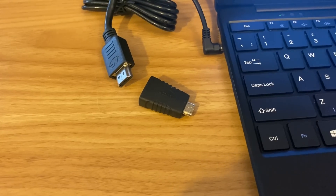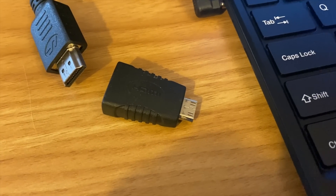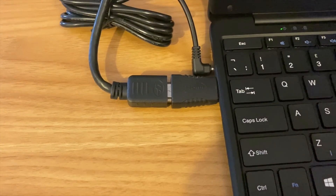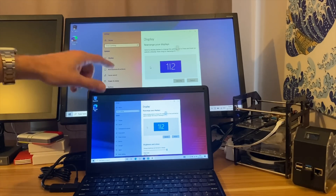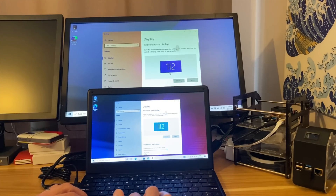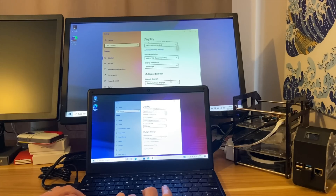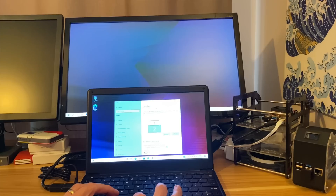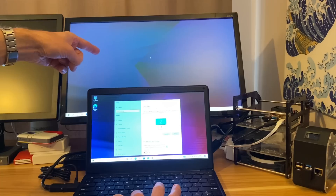If you want to plug this laptop into your TV, you'll need a mini HDMI to HDMI adapter and then a normal HDMI cable. It supports dual monitor display — right now they're showing the same content, but if I scroll down and pick 'Extend these displays' and keep the changes, I can rearrange the displays so one is above or below the other. After applying, I can scroll up to the top of my screen and it appears on the top monitor.